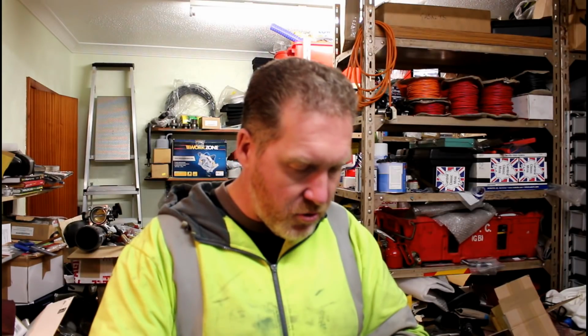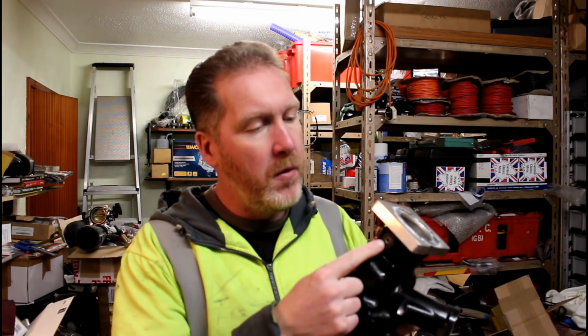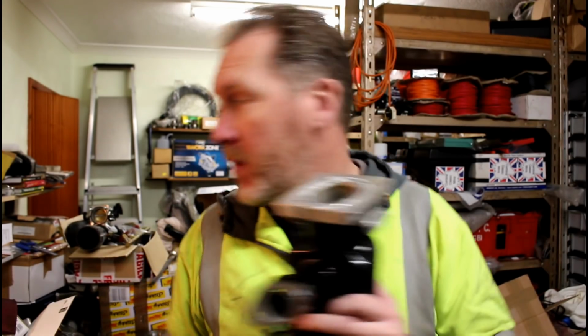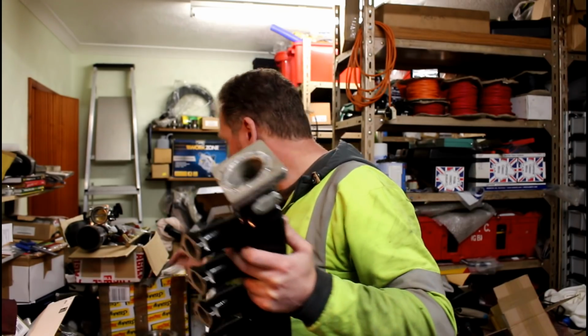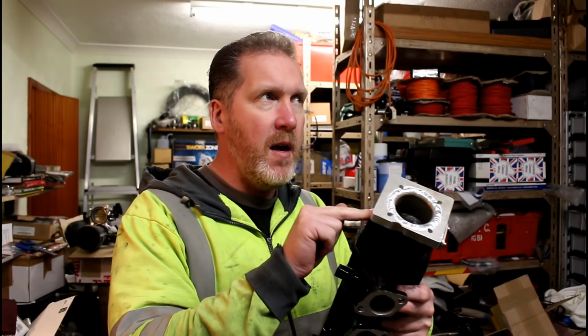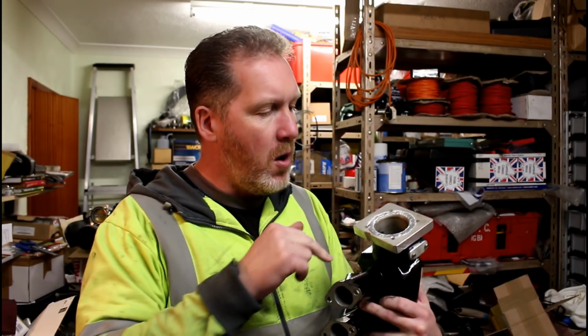So that's to do. I'll also drill and tap that to 1/8 MPT for that little brass union, wherever I've put it, somewhere safe. And that one there needs drilling to M14 by 1.5, which is one of the parts that came the other day. Set of taps, and that'll be for the, what's that one for? That's the air temperature takeoff.